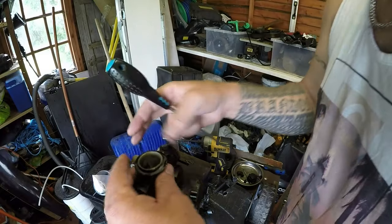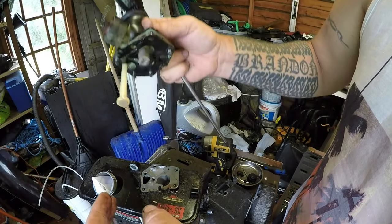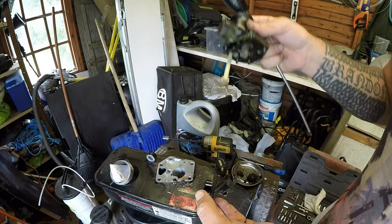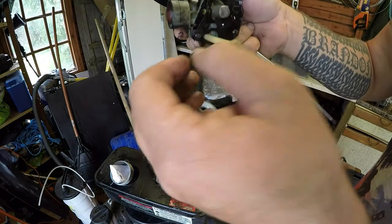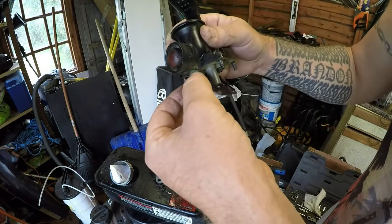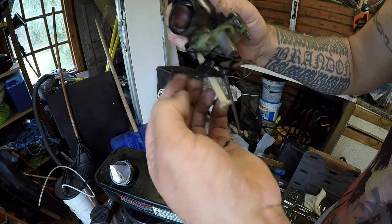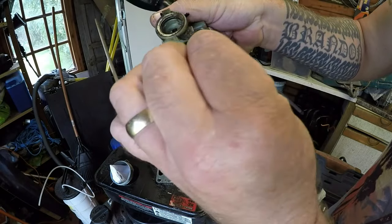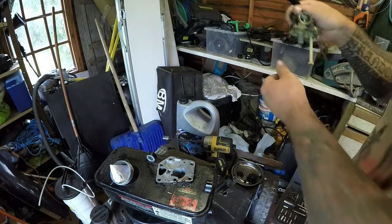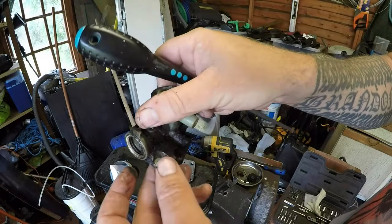Is that going to come up there? Here it comes. Gasket, yeah, I put a new gasket on that. And that's why we got all that oil sat in the bottom here as well. The gasket's probably had it, so I'm going to renew that anyway. It's sticky, it's horrible. It certainly won't be doing the job it's supposed to be doing. There it goes. Let's get rid of that. That's yucky. Well, that's going to be cleaned off with carburetor cleaner. There goes the screw.